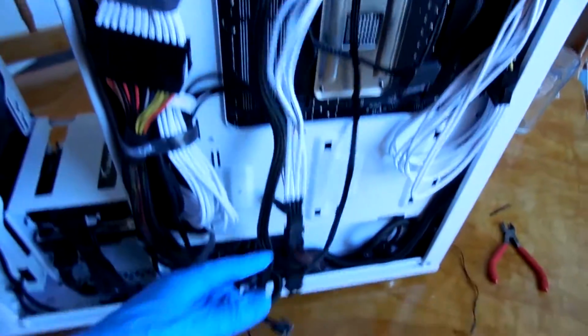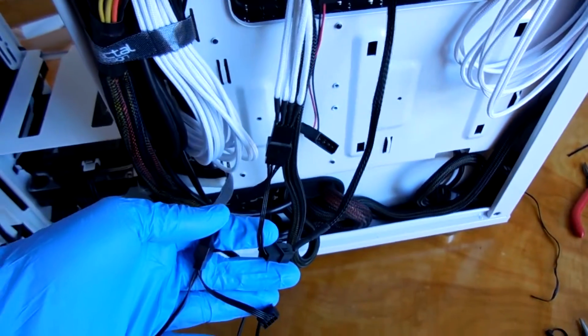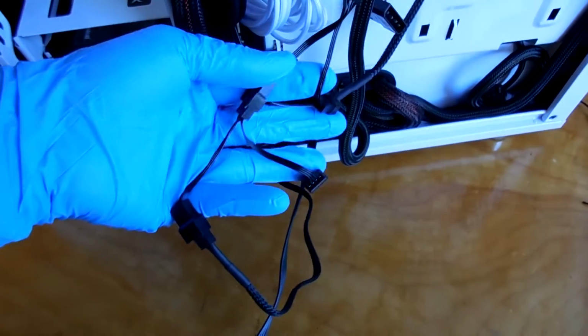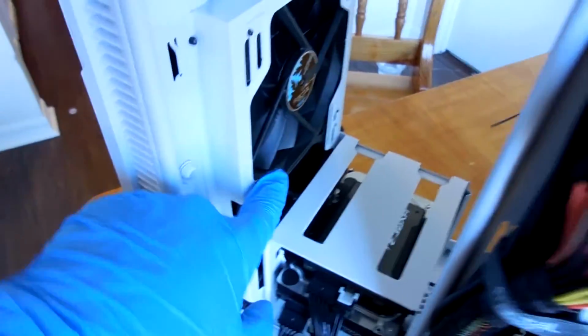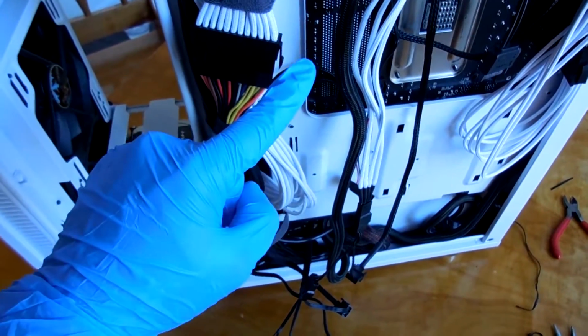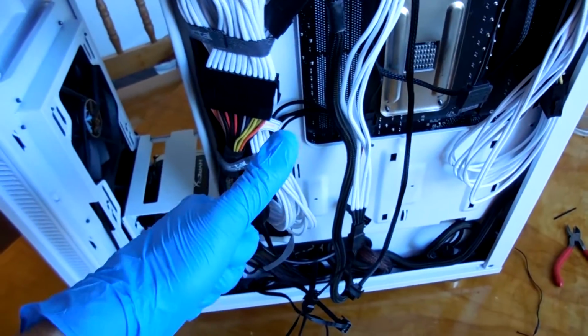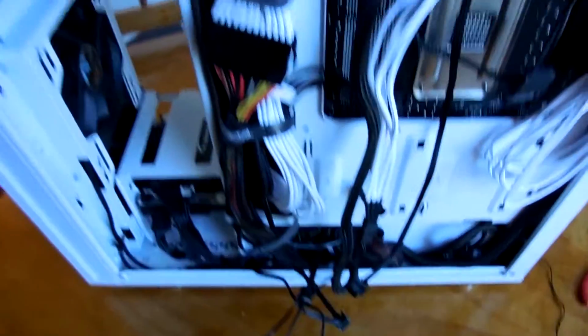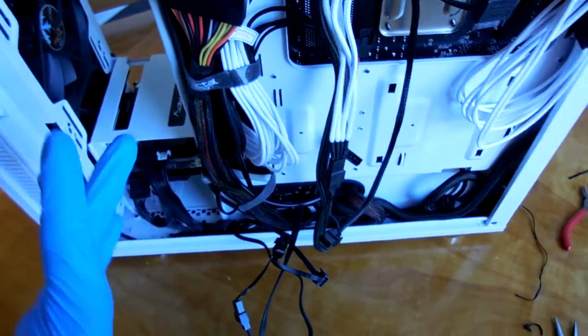Okay, so real quick, I wanted to show you guys how exactly I'm powering the 3 case fans in my system. So I have this 4-pin extension that I told you guys about earlier for 4-pin pulse width modulated fans. I'm basically daisy chaining 2 of the Y connectors that come with the Venturi high pressure fans to run my 2 HF14s in the front, as well as my HF14 in the roof here. This motherboard, it's an Asus Sabertooth 990FX R2.0, in case you guys didn't catch that. But it is capable of controlling all of these fans, despite them being 3-pin off of a 4-pin header. So kudos to Asus for, again, rock solid fan speed control. I have been running this configuration for a couple of days now safely. It doesn't give me any issues whatsoever.